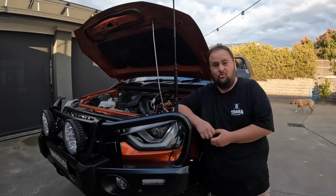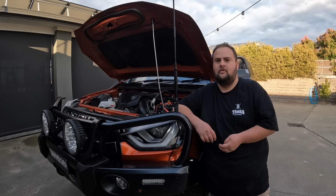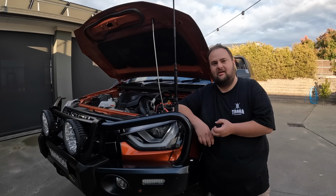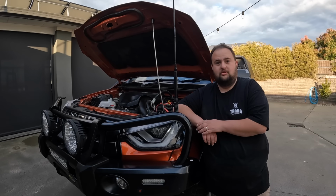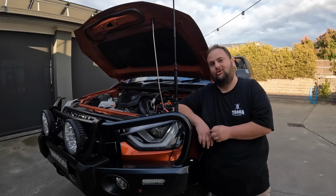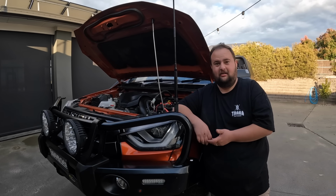Not much you can do with them. Just have a quick look around. You would have known we've had brake issues before going down Mount Ousley. So we got the front brakes upgraded to heat treated and bigger rotors, which disperses the heat better. Since getting them done, we haven't had any issues going down the hills. But we've also culled a lot of weight out of the car and van. Now we're pretty much legal, but this will be in another episode.